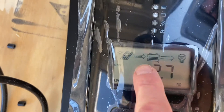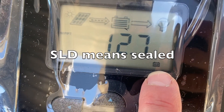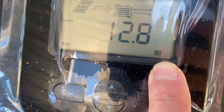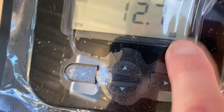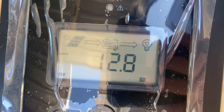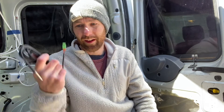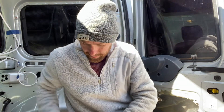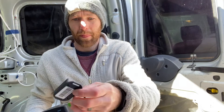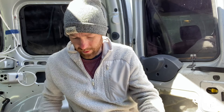So we moved out in the sun - it's cold and windy, but we got a little sun icon there. It looks like we're getting 12.7 volts. I was reading from Renogy that it needs to be set to SLD for AGM batteries - there's an actual AGM setting. I'm just going with what Renogy is telling me since it's both their charge controller and battery. So it is charging the batteries. I downloaded the Renogy DC Home app - it auto detected the Bluetooth module plugged into the RS232 jack and told me the battery is charging right now. Which is pretty sweet - another step done.